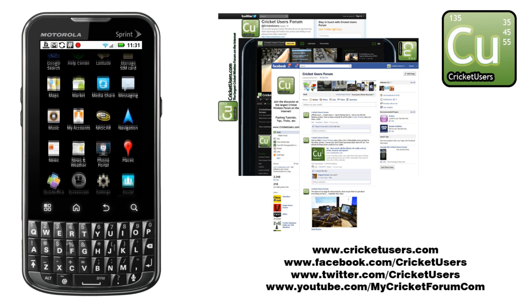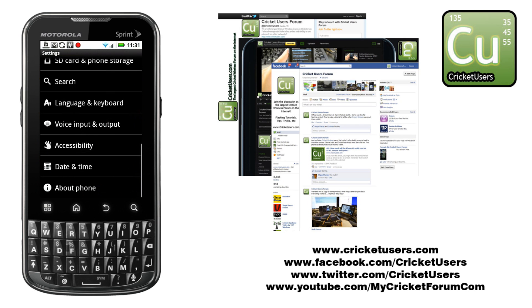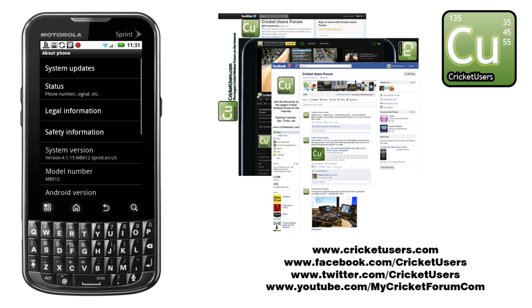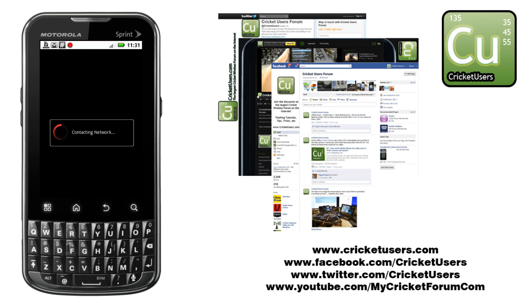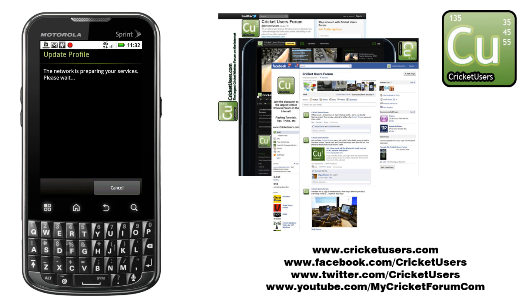What we show you here is our Wi-Fi 3G fix, or what we think fixed it. We go into Settings, About Phone, System Updates, and then we hit Update Profile. We let this run for a little while and then canceled it as you see on the video, and then we rebooted the device. After that, when it was connected to Wi-Fi, the 3G icon would drop like it was supposed to. We were worried this might cause extra data usage or a conflict in the data resulting in no data at all. But basically, if you weren't experiencing these problems, you don't have to go through that section.